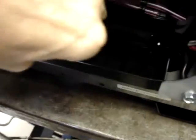is going to need to be trimmed to where it's about a half an inch to the right of this flange, and that way it'll give us enough room to put the fuel filter on it without the fuel filter coming in any danger of hitting that flange.